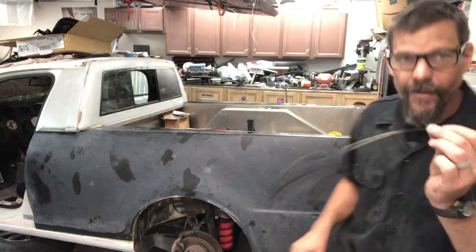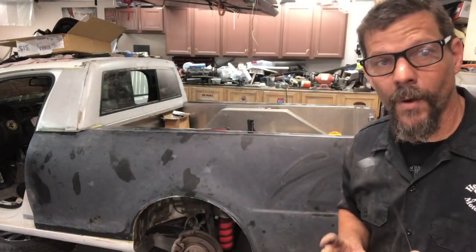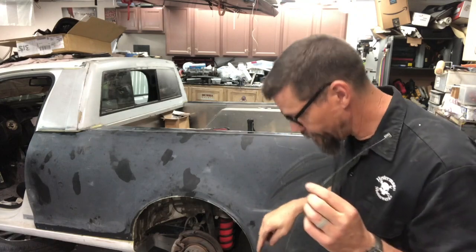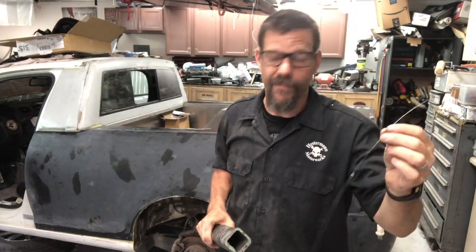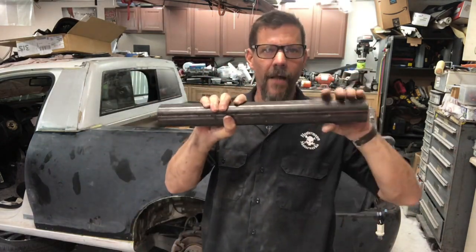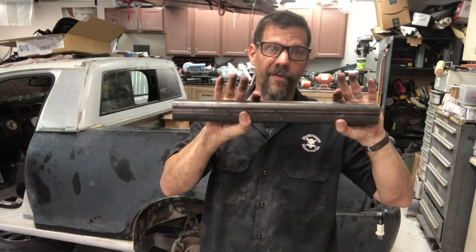These little wire fishers are awesome. Basically you thread a bolt onto that and then push it up through the frame and pull it down, bringing your bolt out. So you can do bolts instead of going all the way through the frame — you can go through one half of the frame from the center of your two-inch box. This comes with most hitches; that's where I get them and I just save them. So now you've got a solid, frame-mounted point where you can weld or bolt a hitch to.